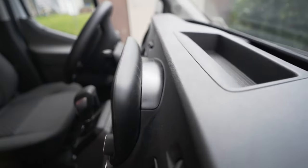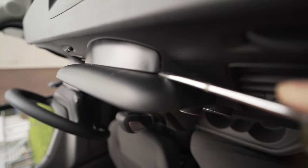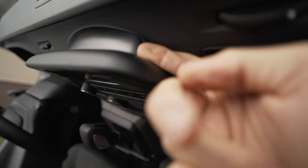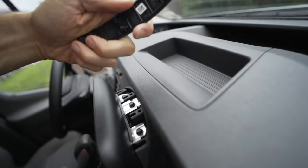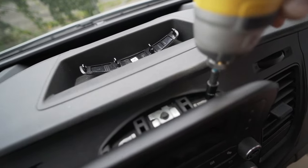First step is coming around the back here. I just wedged the screwdriver right behind there and turned it a little bit, being really careful. I don't have a small enough spudger to get in there. I did one more spot in the center and then it popped right off — these are 7 millimeter screws right here.